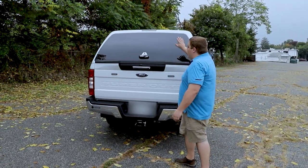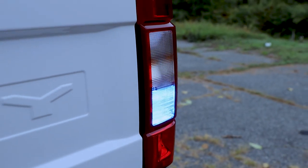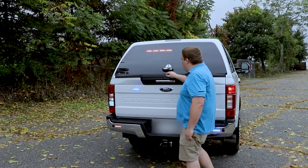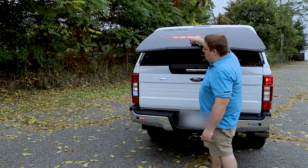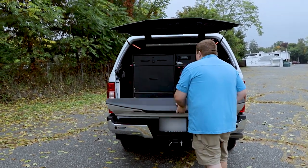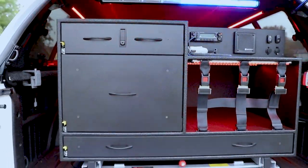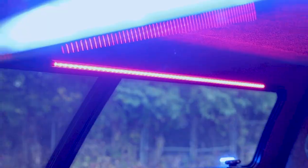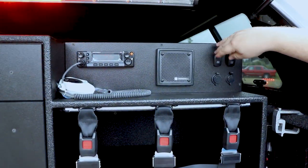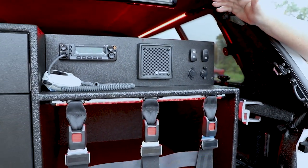Taking a look at the back of the vehicle, we've got an eight head N4 stick mounted behind the glass. We've got four inch M powers on the bumper and the rear tailgate. We have SoundOff Signal hideaways mounted in the tail lights, and the white lights on the back do the white override to provide additional scene lighting. We installed this ARE cap — we spec'd it out — with electronic locks on the back that tie into the factory key fob. With the tailgate down you can still see our rear warning. We installed a pin switch that turns on our scene lighting. They've chosen to have a red-white Amdor light, with lights mounted throughout the cabinet that can be either white or red with just the flip of a switch. We also installed a kill switch to kill the rear stick so it's not blinding them when they're working back there.